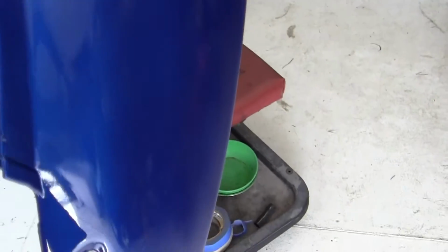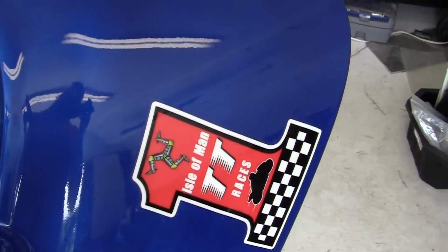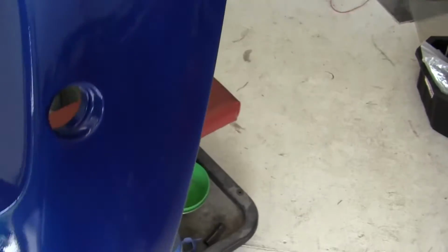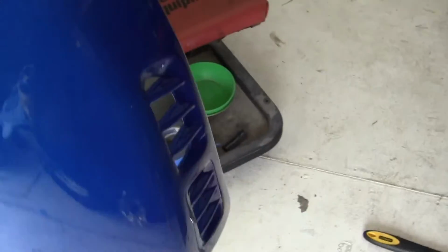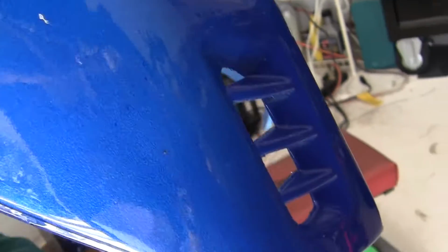And after I get this done, these 2 coats, I'm going to go over it with 2000 grit, probably, get all the little tiny flecks and rough spots out of it, which there are a tiny bit, and then I'll polish it. I'll polish it like glass. And you can do surgery, brain surgery. And you can see my hand. I don't know if you can see my hand. Can you see my hand right there? Maybe. You can see my reflection right there, I think. I'm not quite sure. I can't see through the camera lens.